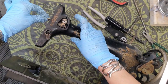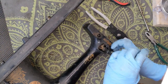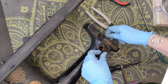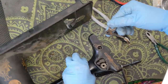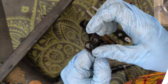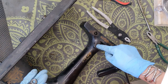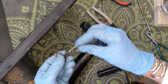Let me go ahead and turn it over here and take out this big old flat screw to pull out this thread lifter. She is coming loose pretty easily. Then I just need to wiggle this piece out. This little bearing here — is that going to come off? No, it's not going to come off. That's good, that will stay put. That's what travels inside this little groove here in the end of the main shaft — there is a little cog with a groove in it. This travels up and down in there, and that's what lifts up the lifter lever.